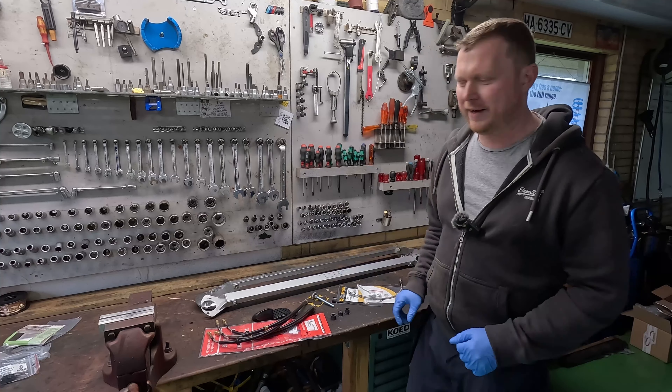Now we have clear fluid. The reason it's red is because I rebuilt these calipers using some red grease, and although I bled them before it appears the red grease has started to dissolve or something — I'm just guessing, but usually it's not red. There's lots of air here as well. What I like to do is press the brake pedal a few times, smack every caliper with a hammer a few times, and then bleed it again. Taking a closer look at the gauge, we still have plenty of pressure left.